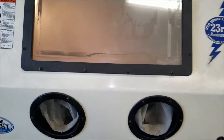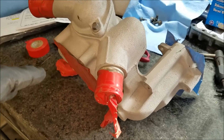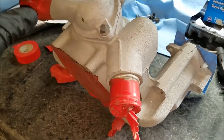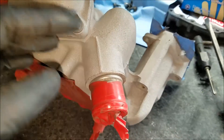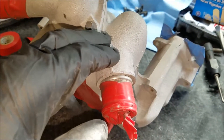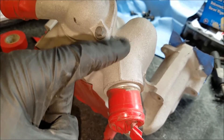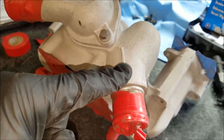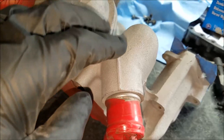This is the sandblast cabinet — it's actually working really well. Here's the water pump after coming out of the sandblast cabinet. It cleaned up really well; it just takes time to get into all the grooves. In hindsight, I probably would just use the aluminum etching spray — I think it's made by Meguiars and is designed for uncoated mag wheels, but it works great on aluminum suspension parts, water pumps, and similar components.